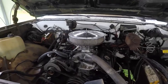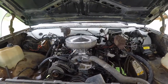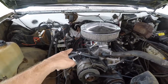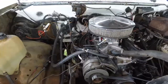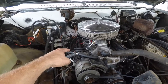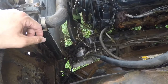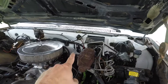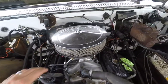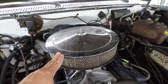It's time to call this project done. This thing looks way better than it did, but it is far from perfect. This is the 1988 truck — as far as I know, this thing hasn't been washed since 1988. We got it pretty clean though. The valve covers have some gunk and grease I just cannot get off — they're kind of rusted anyway and look pretty bad. I think replacing or painting the valve covers is a pretty simple thing to do to dress up an engine. The steering gear is still covered with all kind of stuff — I got it a lot cleaner, but not where I wanted it to be. The firewall looks pretty good; a lot of that black you see is just where the paint has come off. It's got a lot of surface rust, so I'll address that in another video — maybe with a wire wheel or a Scotch-Brite pad.